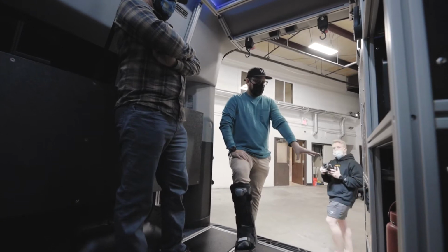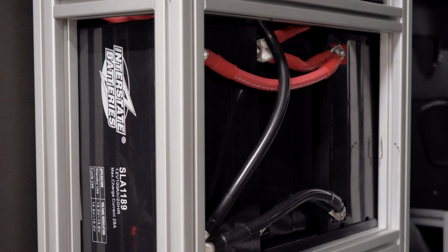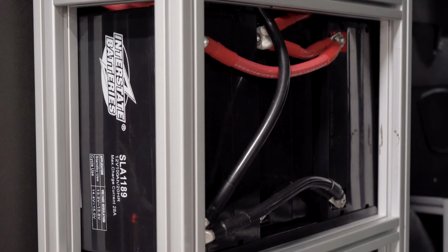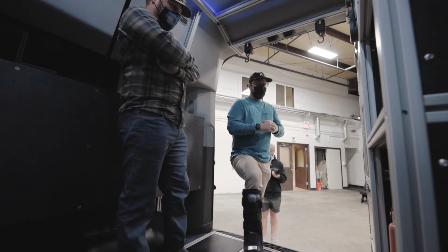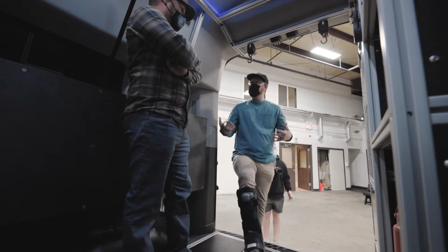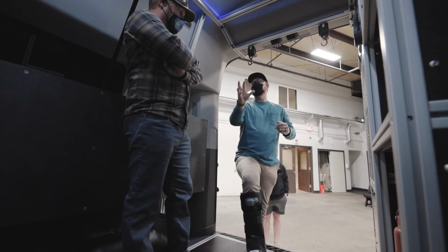The layout is going to start down here with our batteries. So you have 3 100 amp hour deep cycle AGM batteries. They are wired in parallel, so they're acting as one giant 300 amp hour system. The basic charging layout of your van is we have our batteries in the back. People call them house or secondary batteries. And then you have the factory Ford ones up front under your car seat.